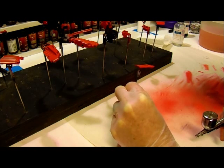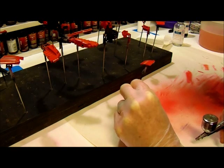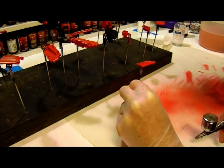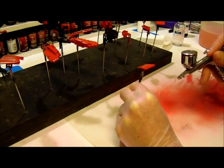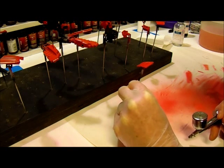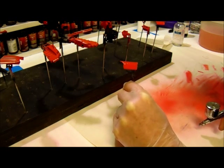You can see it's not a bad looking clear coat, but I don't care for the orange peel. I'm going to try and buff that out. If I were to buff it from here, I'd run the risk of sanding through the clear coat into the red, and possibly down to the plastic or the primer. So I'm going to go ahead and shoot all these, then pick up on the next step.